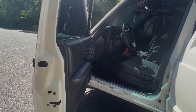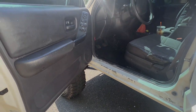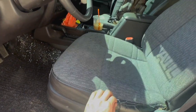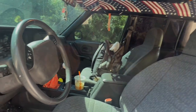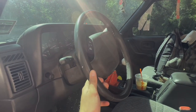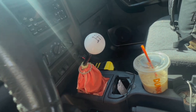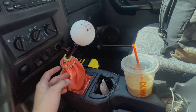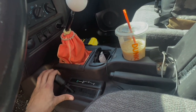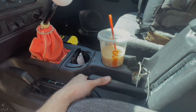As far as the Cherokee interior goes, I've left a lot of it as stock as I could. The steps are getting a little beat up. The door I have not touched — it's all stock. I have some bags and pockets on the seats, got a little rip in one which is nothing unusual. Gray interior, dash has been all left alone. My steering wheel is upside down — I have not adjusted it after I did the steering. It is a five-speed manual swap: it has an AX-15 to a 231 transfer case, five speed. We got a Crown Royal bag as our shifter boot, and we did have to do aftermarket linkage for four-wheel drive, which I've been having issues with adjusting and it binding up. Right now the emergency brake is hooked up but not adjusted.